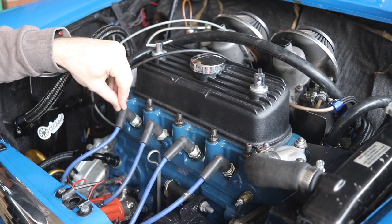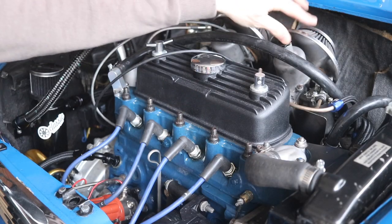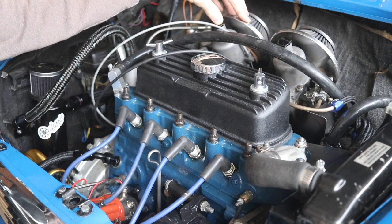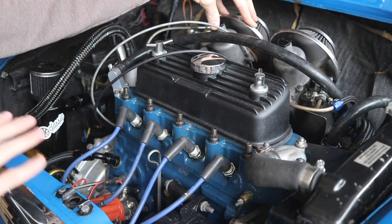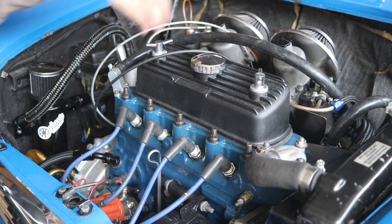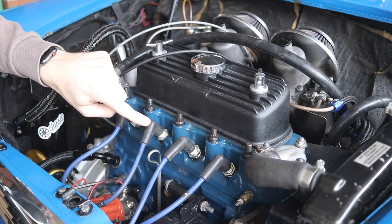If you have dual carbs, it's a little bit different because the way the flow works is it's split. These two cylinders, one and two, get the air-fuel mixture from this carburetor, and then three and four get it from this carburetor. This is what I was talking about when I mentioned synchronizing the carburetors — you want your carburetors to have the same amount of fueling on each side of your engine into all of the cylinders; you want it uniform. That's going to make your engine run the best. Let's get started with cylinders four and three — I'd recommend picking the two center spark plugs, so we'll start with this carburetor and cylinder three.